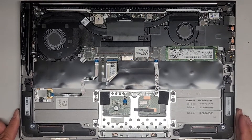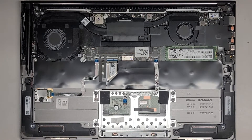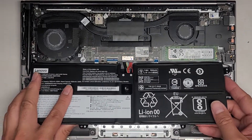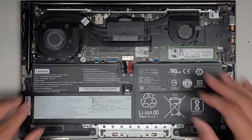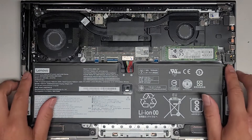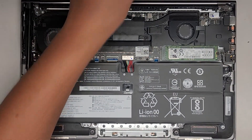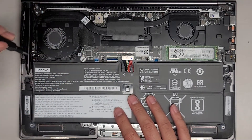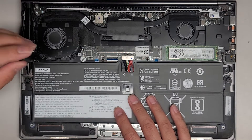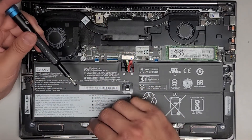This is more of a quick look inside — just showing you how to get into the laptop and what components are visible on top. We're going to get this back in and pinch this back into place, get this all lined back up. We'll get these four screws back in. For the most part, it looks like the screws all come out with a PH0 or JIS0 screwdriver.